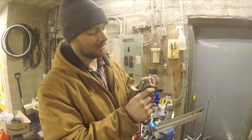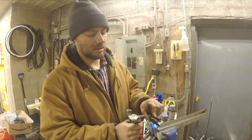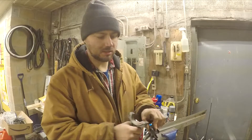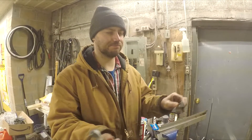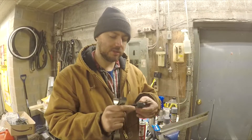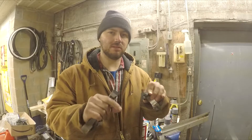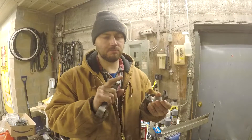Here I have the cap for rod one. There's a little sleeve on the backside — I'm not sure if you're supposed to pop that out, but it kind of captivates the bolts. I had to use a socket to screw them out, and for the ARPs I did the exact opposite and screwed them in.